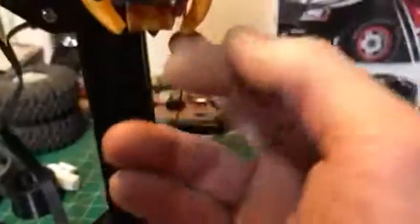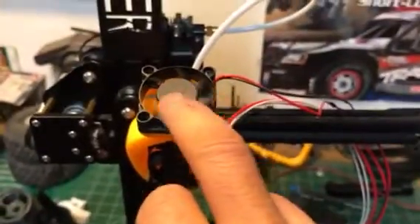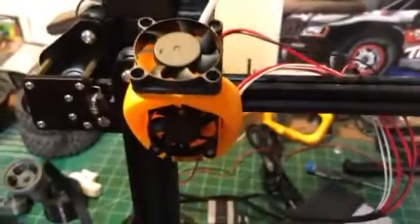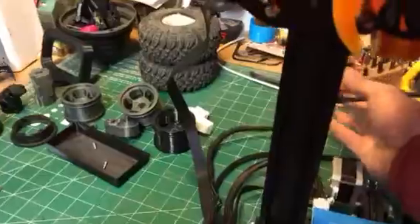That's where you want to plug that guy in. When you go into your slicer and set your fan speeds, your parts cooling fan is actually going to blow down through here and blow across your parts. That's when you set your fan speed in your slicer — that's what's gonna control this guy on that K-fan port. I ran this all up through the factory sheathing so it's gonna run with all the factory wiring and look nice and neat and tidy.